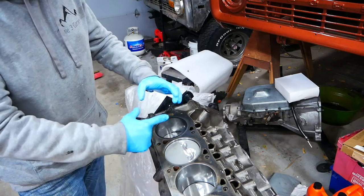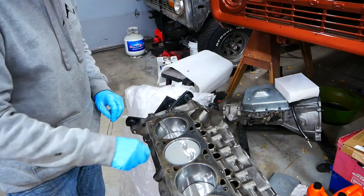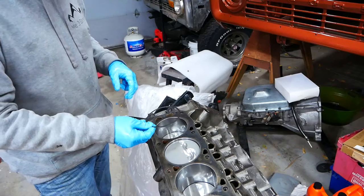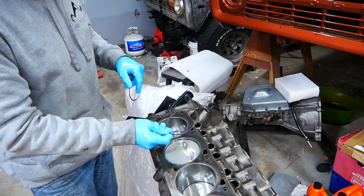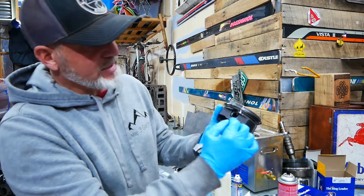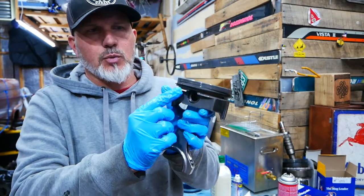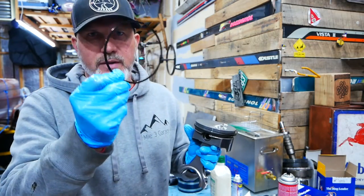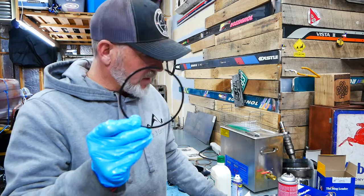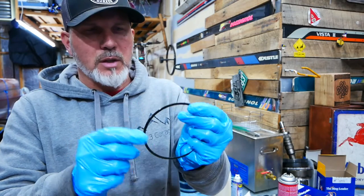When I put it in there I'm going to have to compress it, meaning it's going to ride right up and down the cylinder wall — not what we want. The correct one falls right in; in fact it's significantly smaller than the bore. It'll get bigger when you put it around the piston, but it's still smaller than the skirt and will not ride on the cylinder wall. So make sure you get the right ones. A good support ring will not touch the outside of the wall — it will actually hug the interior face of the piston.